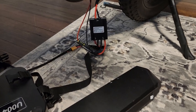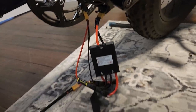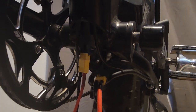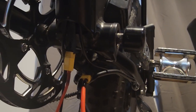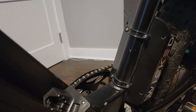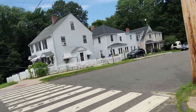We are successful — everything worked out, nothing exploded, no burned-out circuit breakers. I tested them out. To unplug the controller from the default stock battery underneath, there are a couple XT60 connectors. Next up, we're going to wire everything in nicely, make everything neat and packed tightly in the step-through cavity.